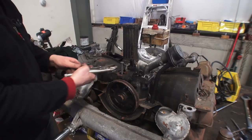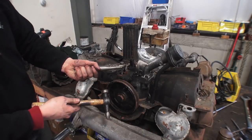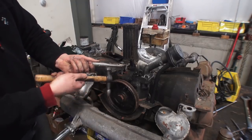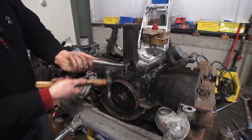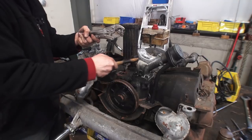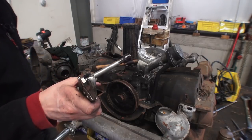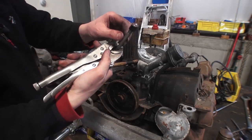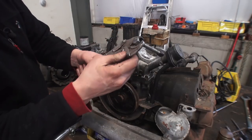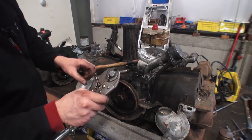Get your vise grips, get some meat on this, nice and tight. Go on the bottom of the bolt right under the head of the bolt and start hammering up. Check it out — I got it! At least part of it. It looks like another part is still stuck in the block. But we got most of it out. You can see you got a good lot of threads through the broken piece — grab enough meat and then get yourself a vise grip. You might damage your vise grip a little bit but you can always get another one.